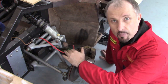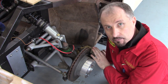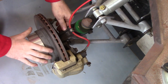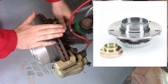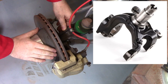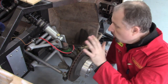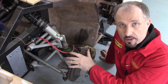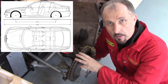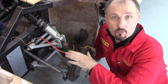So what we have here is a BMW E46 hub carrier, hub, brake disc, and brake caliper. This casting is the hub carrier — it's called that because it carries the hub. The hub is on the inside of this brake disc, which rotates on a spindle sitting in the centre of some bearings inside the hub. This solved quite a lot of issues for me. One of the things you've got to get right with the steering and front suspension of any car is to get the Ackermann steering correct. Because the BMW E46 has a wheelbase very similar to my car — only slightly longer — and I've pushed the hubs out just a little bit, the Ackermann steering actually worked out really well.